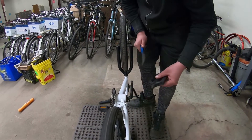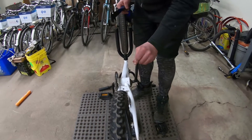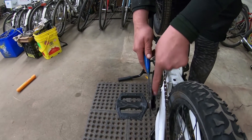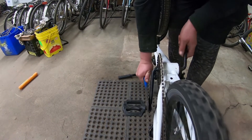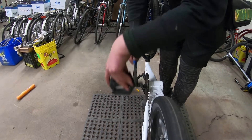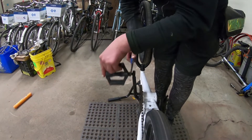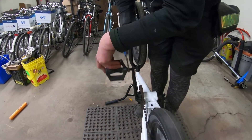It'll take a few rotations, but those are the threads. Then you'll do the same process on the other side. You want to have a horizontal alignment with the cranks and just press down and rotate. Sometimes certain pedals will be rustier than others, and sometimes the alignment won't be right so you have to rotate the tool a little differently, but it's pretty much universal on all bikes.